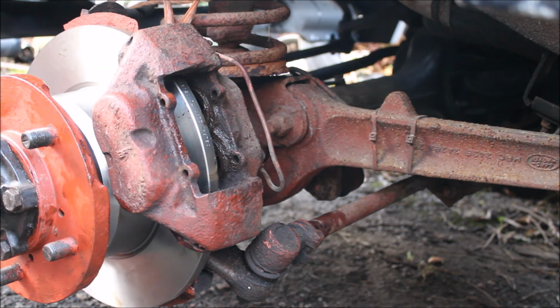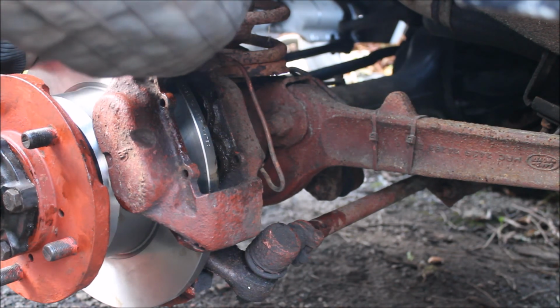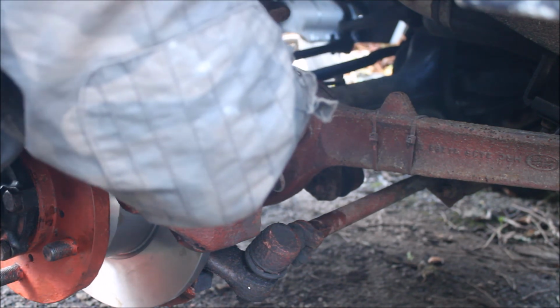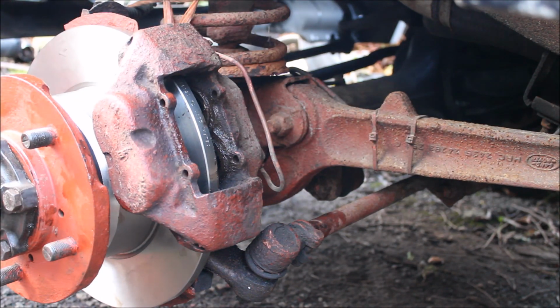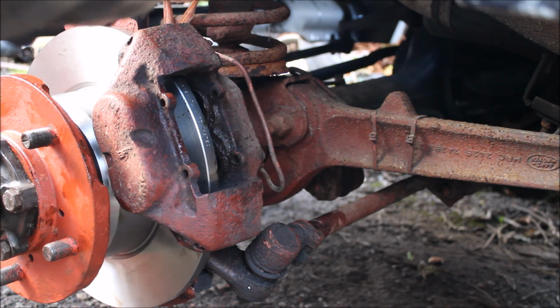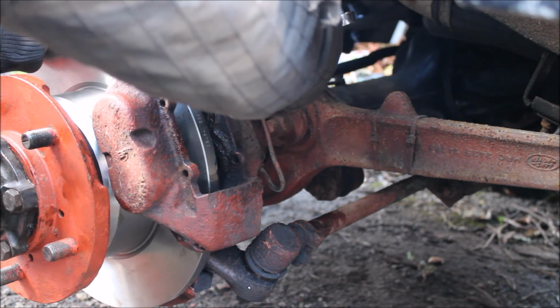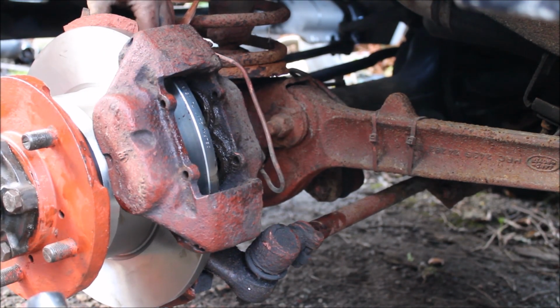So we've got the two bolts here, I think they're 17mm. They go back in the top plate we took off. One of them was slightly hard to get out if I remember, because the brake pipe was in the way, but it might go back. Let's just tap it in. Tapping it fast, there we go.